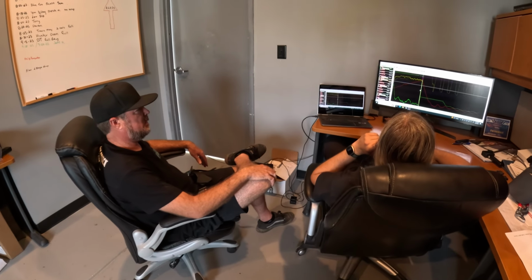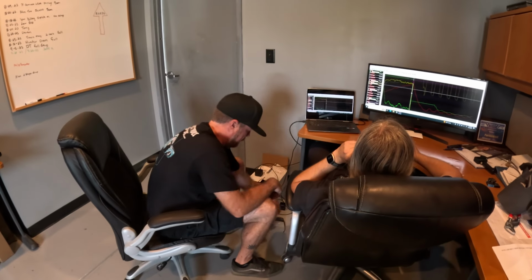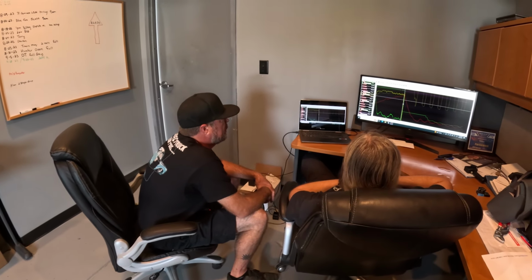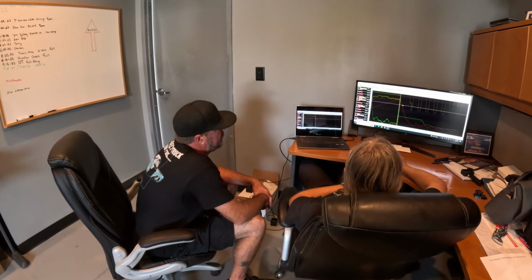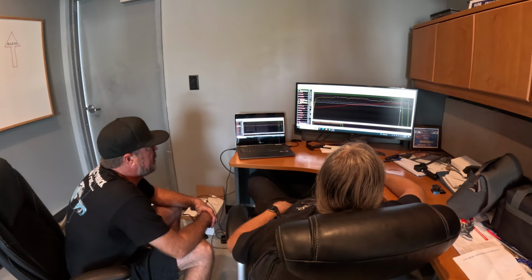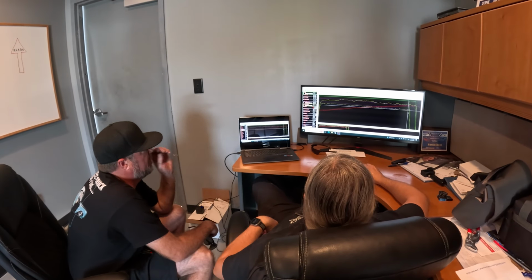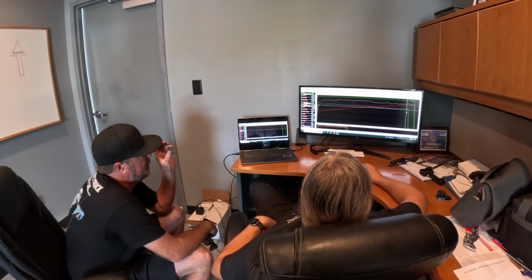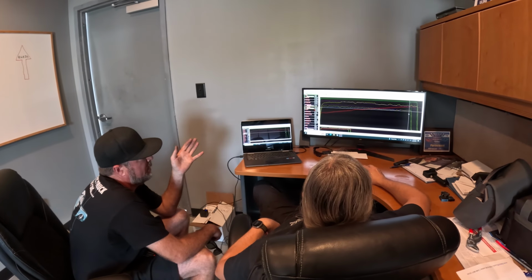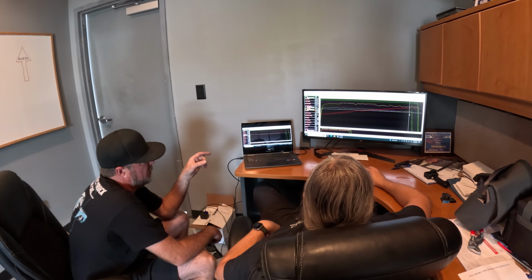All right, well, the air is definitely hotter. At the end, we're 235, where before it was a little less than 200. So we pull the other one in here. Yeah, it's about 40 degrees cooler. With slowing the blower down, less boost, cooler air resulted in 980-ish at the tires. We made more boost, but the air was 40 degrees hotter.